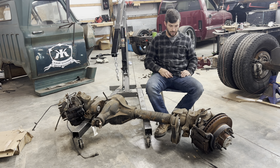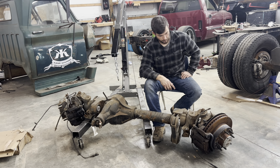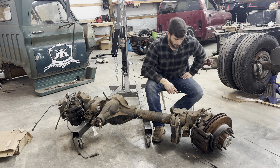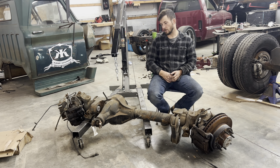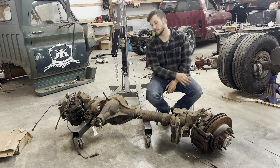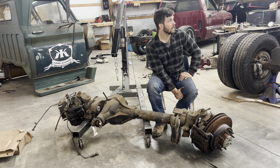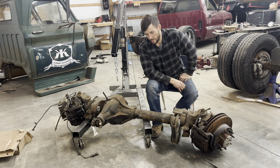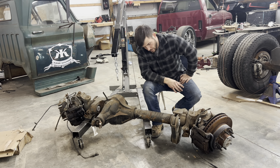I'll get you guys a better look at this axle from the front and back. These are pretty heavy-duty axles — I could have used a Dodge axle but I think these are a little tougher. I don't remember the spline count. I'll probably end up having to change the gears — these are 3.73s in this front and my rear axle is 4.10s. Obviously I want some low gears because I'm going to be running big tires and there's going to be some weight — I may even go lower than 4.10s in the long run.